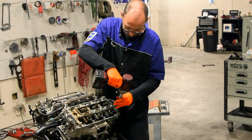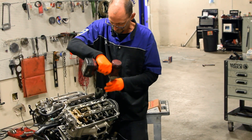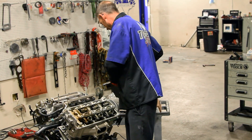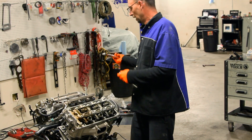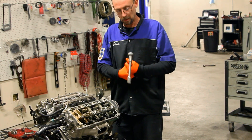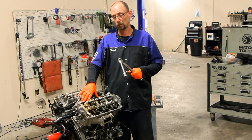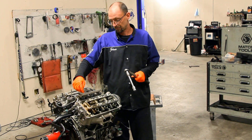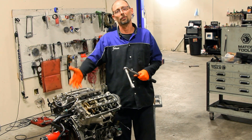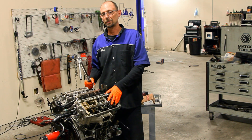There's a specific pattern for these that I'll get to in just a second. It takes a lot of focus and paying attention when you actually start tightening these, because you get one shot with these bolts. If you're in the middle of your torque sequence and forget where you are — some of these bolts require two degree readings after the initial torquing — what I'll do is use a Sharpie and once I've torqued it to its first angle reading, make a little mark on the gasket surface by that bolt so if I get distracted I know where I left off. This one calls for 22 foot-pounds on the first pass.